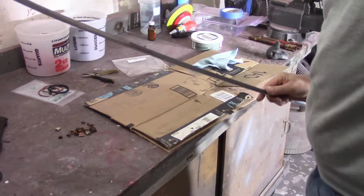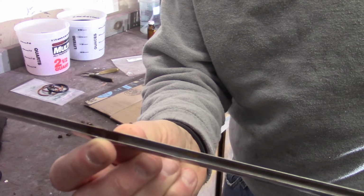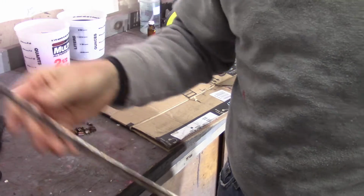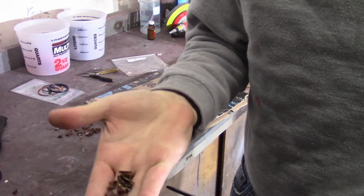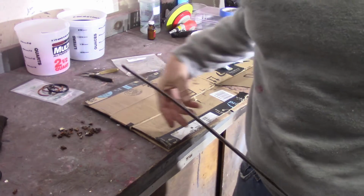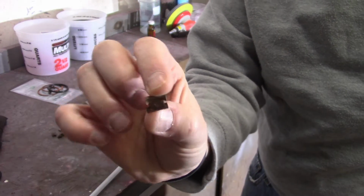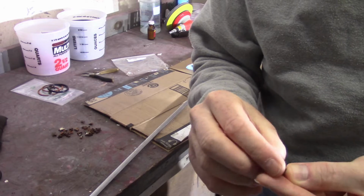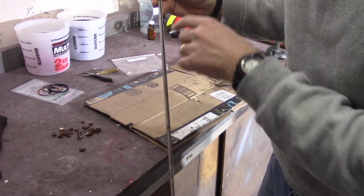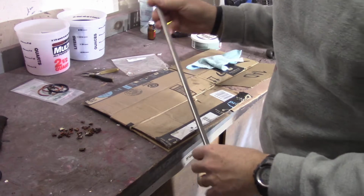The interesting thing about these, and I'm not sure how well it's going to show up. See that discoloration right there? It's rust. A couple rust spots in here throughout. And what the rust is from is these clips here that stick it to the car. And the interesting part is you've got two different clips, two different sizes. You've got what I would consider more of a standard clip, and you've got these little guys right here. So inside, where you can see the rust, there's some that are separated by a little bit, which tells you that there's two little clips in there.